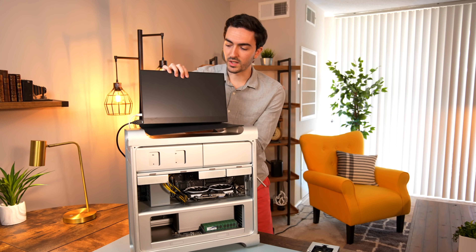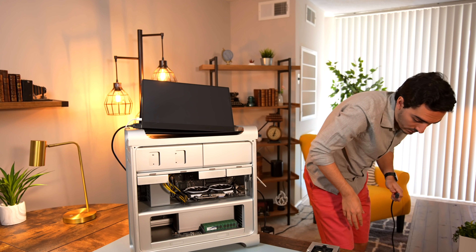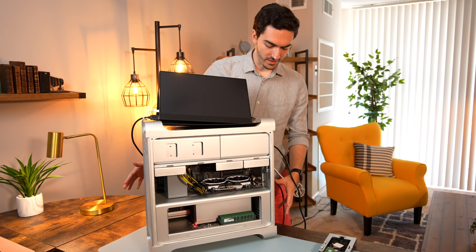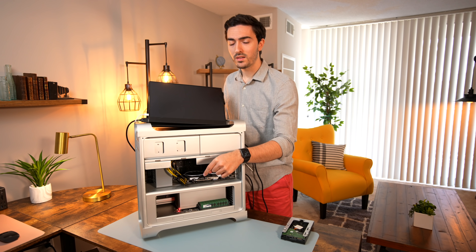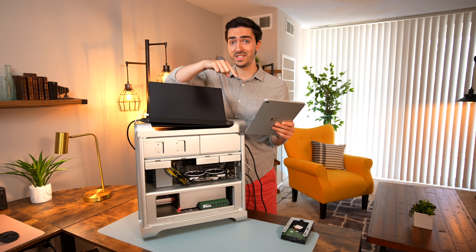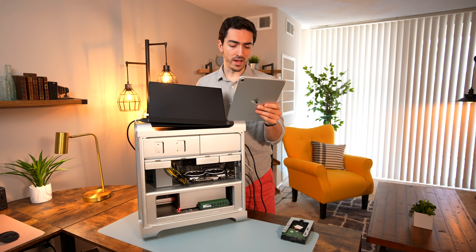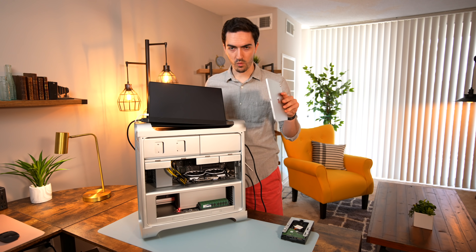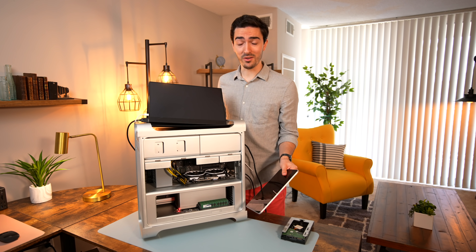Graphics card is in. There's a hard drive right up here — it's a Western Digital 1 terabyte. Since we're dealing with a boot issue, I want to know there's a good drive in here, so we're going to plug in a random 120 gigabyte SSD that I'm pretty sure has El Capitan on it, which should give us the best possible circumstances to isolate what's wrong. When you have a custom graphics card, you don't see the boot animation with the little slider.